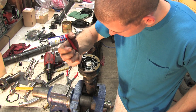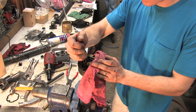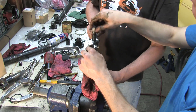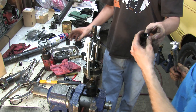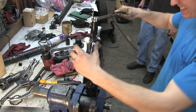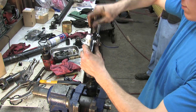The Lobro joint is only held on by a snap ring and a band clamp. Once it's out of the way, removing it from the shaft is easy with the exact same tools you've already been using. Your two jaw pullers make removing the Lobro joint an effortless operation.